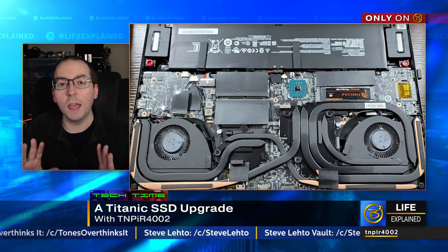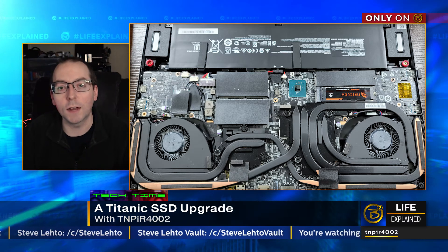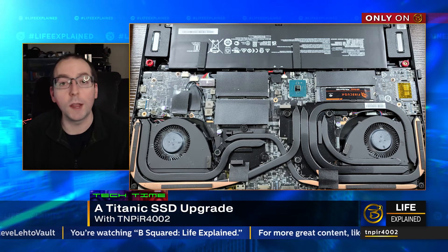After some research, it turns out this drive is not compatible with the infrastructure of the Titan. The Titan was set up to use a SATA interface, whereas this was a PCIe drive. It's not the first critical research failure I've ever had, but it is the latest. So that's two research failures on this one procedure: I forgot which drive was in what slot on the Raider, and I didn't think to check beforehand whether the new drive could fully interface with the Titan's older infrastructure. I now have a 2TB NVMe SSD that I'm not quite sure what to do with. MSI, if you make another system like the Raider, please build in a third SSD slot — it would have been really nice to have both a 2TB and a 4TB SSD in the Raider.